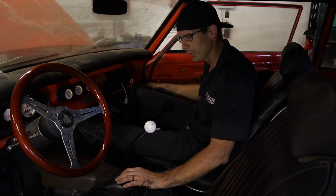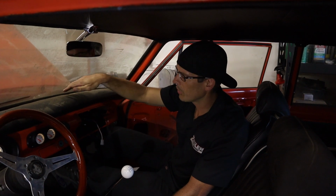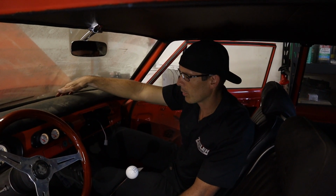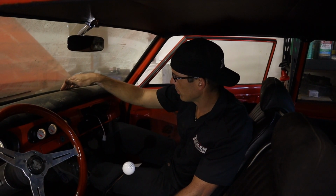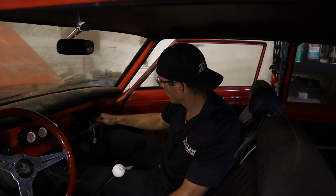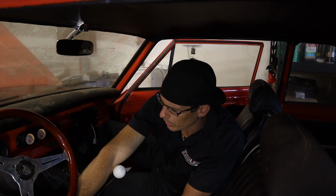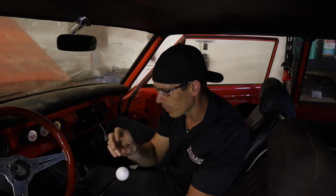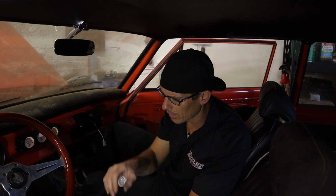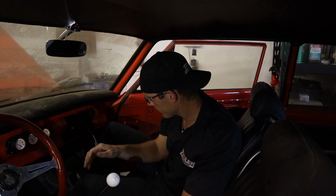I'm going to do the fuel lines on this side because of the way the bulkheads are. If you go back in the videos before we put the engine in, we did the little bracket up here on the firewall with the bulkhead dash 8s. It's more on the passenger side, so it'd be easier to run the fuel lines down the passenger rocker panel, and then the brake line's going to go down the driver's rocker panel. We added the bracket for the park brake cable and all the last little brackets and odds and ends that still needed to be welded on, everything for this floor, all the little brackets for the seat and everything.